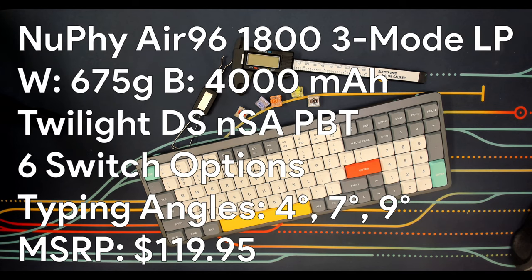Let's get technical. Today we are taking a look at the NuPhy Studios Air96, a low profile 3-mode 1800 keyboard from NuPhy Studios. It comes in weighing at 675 grams fully loaded. Its chin sits at 14 millimeters above the typing surface, while the back sits at 19.5 millimeters, giving you a default typing angle of 4 degrees. This keyboard retails for $119.95 on NuPhy.com, and it goes up from there depending on the switches and keycap options you choose. It comes preloaded with a 4000 milliamp hour battery, as well as Twilight Double Shot NSA PBT keycaps. It gives you the choice of 6 different switches, including Gateron 2.0 low profile switches.